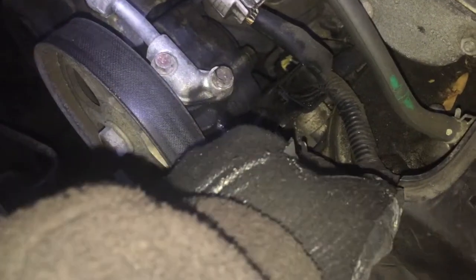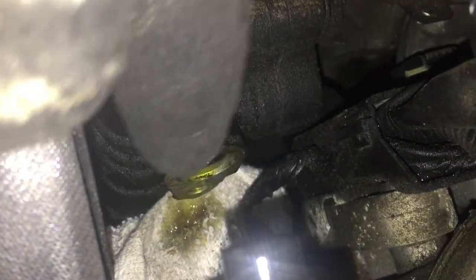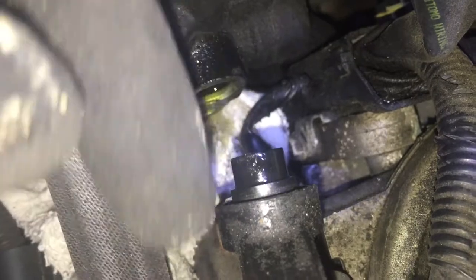Let's pull this out and as you can see there is an o-ring inside — see that little black o-ring? Get it out of there. Now we're going to go ahead and use a pick to pick this out of here. Then we'll install the new orange o-ring around the hose.